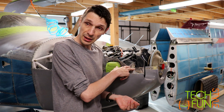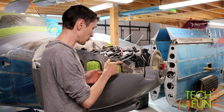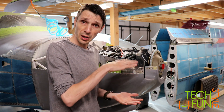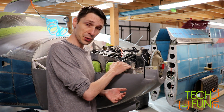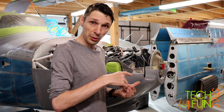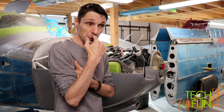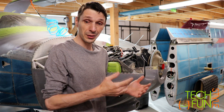I plan to finish my baffling, make the side gussets, basically paint all that and just call it done — partially done, because I still need a hose for the rubber part, but that will be added later. Before the first engine start I don't think I'll be putting on the cowling, so that rubber part can be added later. I'll also have to add the oil door for the top cowling, but that's not absolutely necessary for the first engine start, which I want to do as soon as possible after finishing all the wiring.